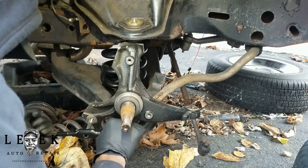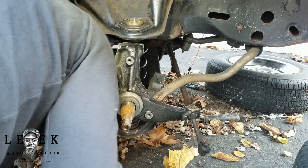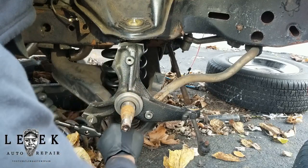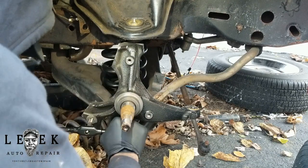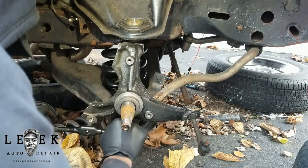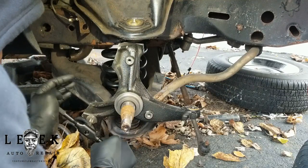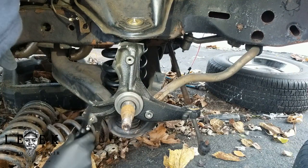You can take out the tap, but I like to wait until I'm done, then put some compressed air or brake cleaner in it, make sure it's dry, and call it a day. You want to drive in about an inch deep — use your eye measurement. Since this hole goes all the way through, I'll just make sure a few threads of the tap come out the back and then drive it back out.